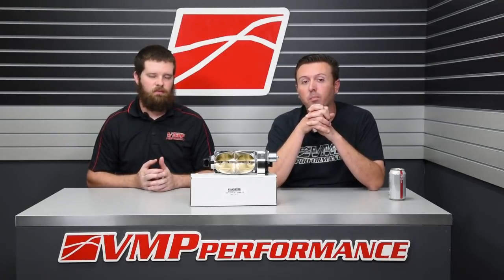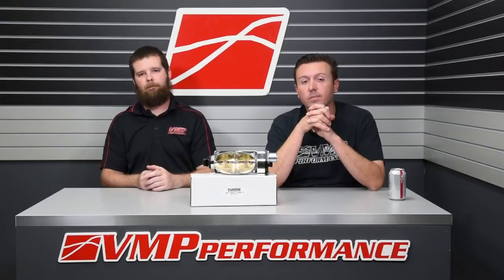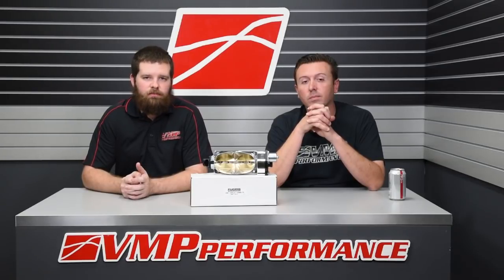We have about 4 minutes left. I'm going to run through these real quick. I'm about to change my plugs, running 15 pounds of boost. I was going to throw some TR6s in, one range colder. What should I gap them at? Any problems with the stock heads and changing plugs in an 01 Lightning? There you go. 15 pounds of boost on a Lightning.